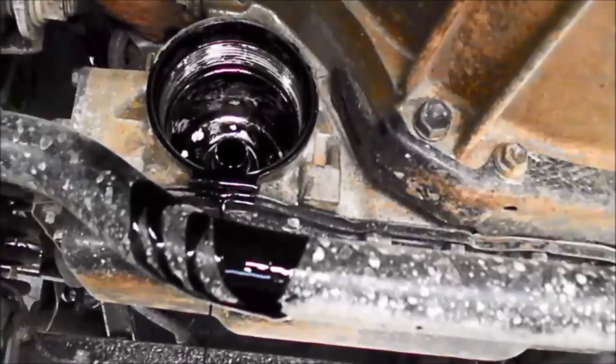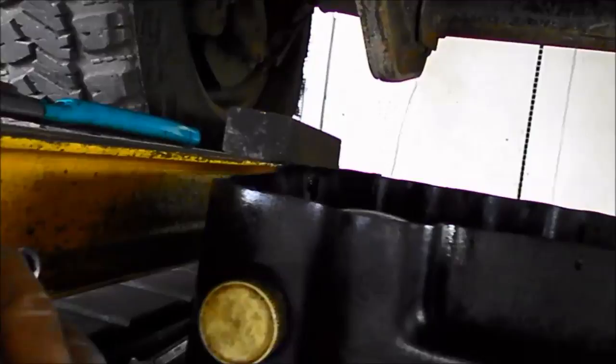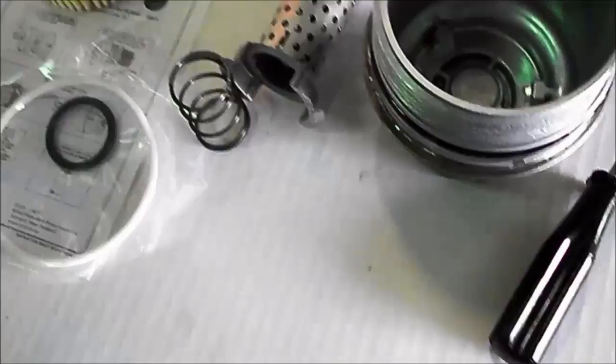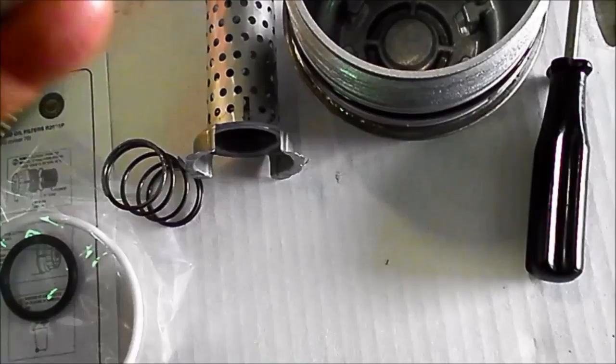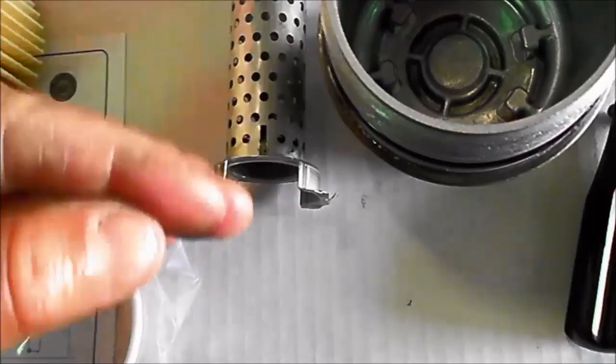Just give it a bit of time for that oil to drip out. When we're taking the bottom sump plug off, on our hoist we can tilt the car back a bit just to get a little bit more oil coming out. Now we're going to replace the filter. This little unit here is a bypass valve if it gets blocked up — it's spring loaded. If the filter does become blocked, it'll push up along the spring and just let the oil circulate so it doesn't seize up.